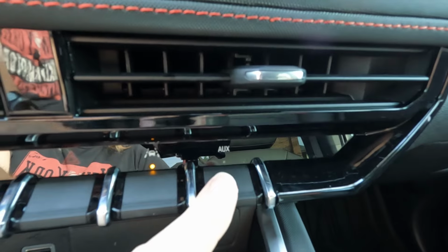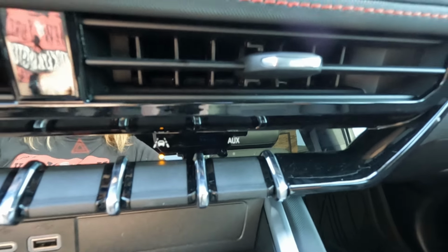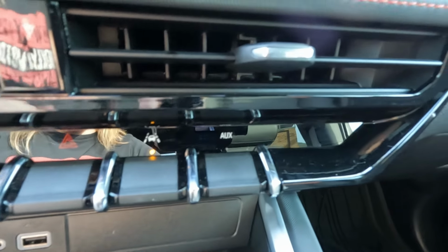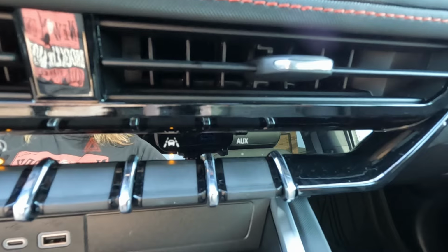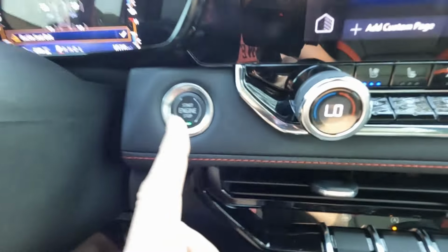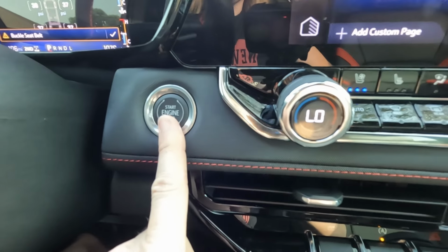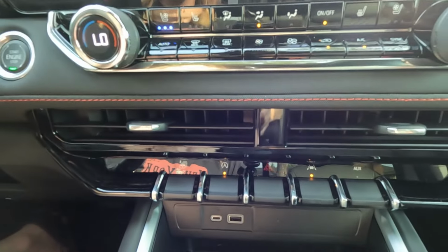Some people thought maybe it was for the 120 volt outlet in the bed of the truck or behind the console, but no, it is not. Those outlets are on all the time as long as the motor is running or you're in service mode, which you do by holding the button down for 5 seconds with the key on and the motor not running. That turns on your 120 volt plugs.